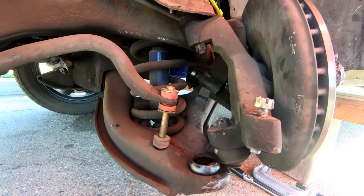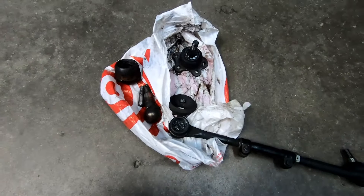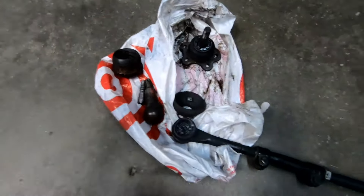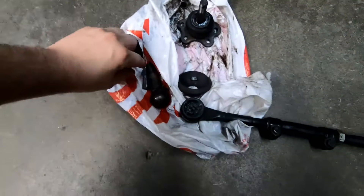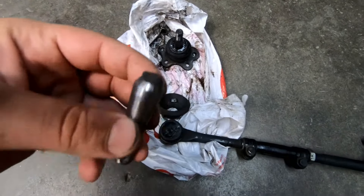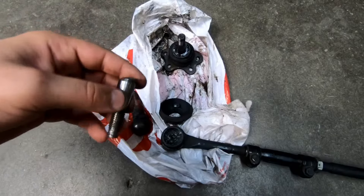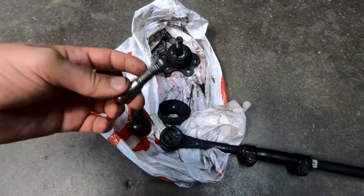We're also going to check out the whole steering mechanism and the sway bar to make sure nothing else got messed up. Here's the damage on the driver's side. The upper ball joint here has no defect or broken components. But on the steering tie rod outer end, it's sheared off here — sliced it right all the way through. I don't think this is a defect; I think it broke because the ball joint broke and all the stress was on the steering itself. The casting or forged spindle had no damage done, which is a good thing.